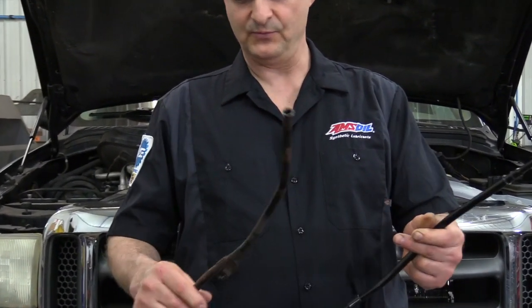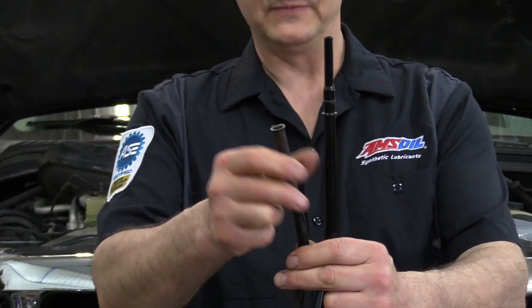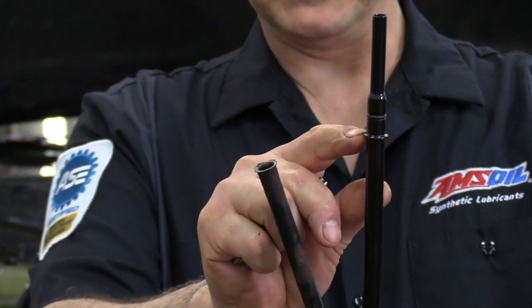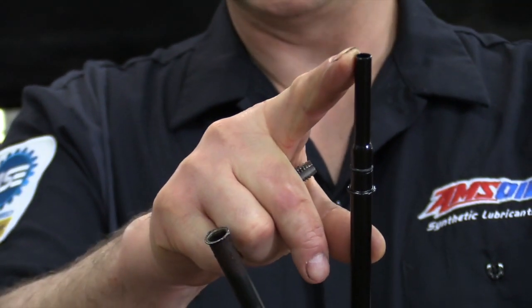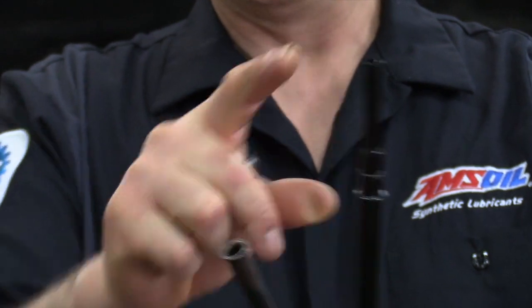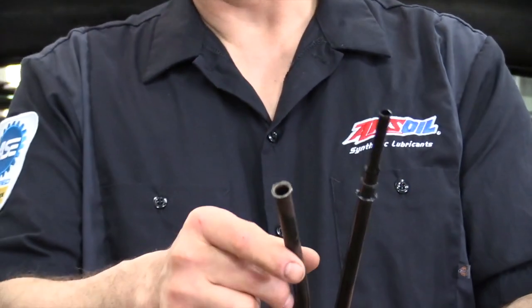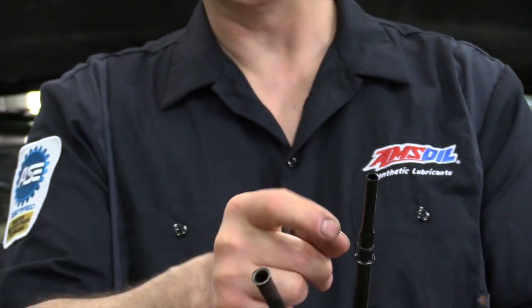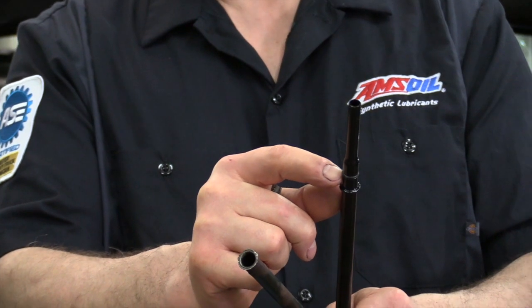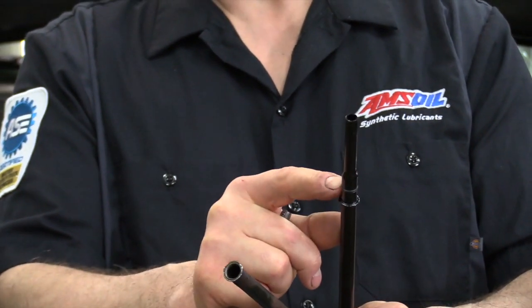What happened here, it gets real thin around that bulge — you can see the brand new one right here. Right there is where it stops into the cast iron block. There's an O-ring seal and then next down where it goes into the crankcase. The biggest problem is there's a lot of junk in the way, plus it's rusted in really bad in the last area between this flange and the O-ring, because that's where the road salt gets in.